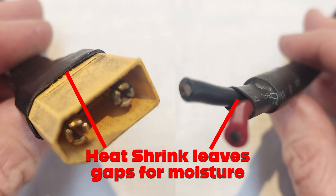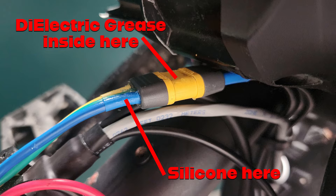You can do some really neat tricks with heat shrink, but I would still use the silicone in the ends. It does a really good job and heat shrink doesn't make a complete seal — moisture still has the potential to get in, as you can see with the gaps at each end. I'm using a bit of silicone on this phase wire connector. There's not much room around the wires but I didn't want to take the chance of having moisture driven in here while I'm riding and shorting the phases.